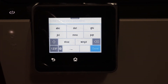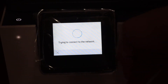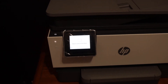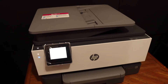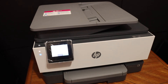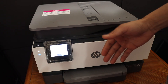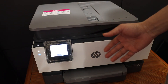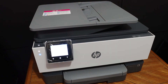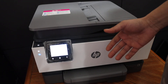Use the keypad to enter the Wi-Fi password, then click OK and it will connect to your home or office Wi-Fi network. You will see the blue light blinking — when it stops blinking, the Wi-Fi connection is set. This may take some time. If you are unable to connect, move the printer to where the wireless signal is stronger. Once done, click OK and the printer is ready to add to different devices for wireless printing and scanning.